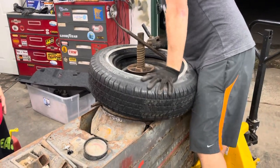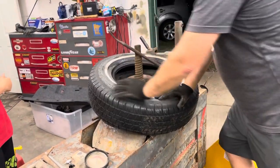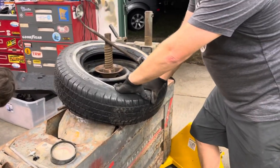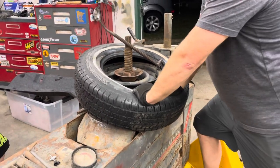A good idea from a video we watched: you've got to push down here to keep the tire in the middle of the low part of the wheel so it doesn't get too tight when it's stretching. You can get your fingers pinched in there if you're not careful - so they say use your knuckles so you don't get your fingers in there. We'll give it a try.